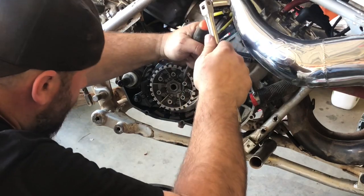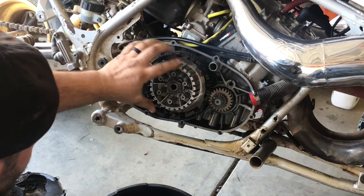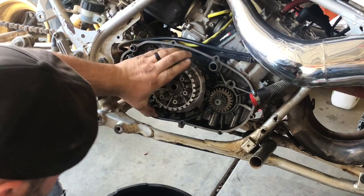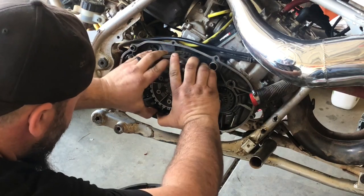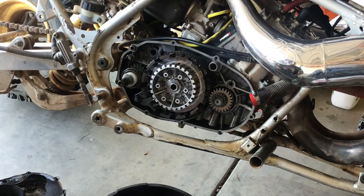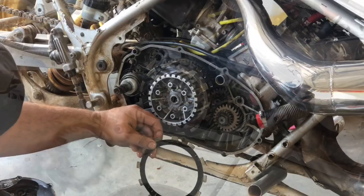And that's it. That's what we want. And it's folded nicely over. That's not going to go anywhere. Our clutch moves. We're in neutral right now, so the bike's got compression. Now we're going to go ahead and stab our plates back in, our clutch plates.